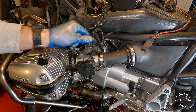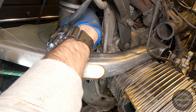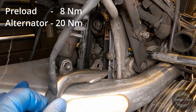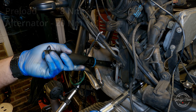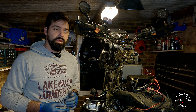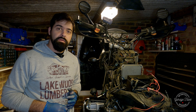Plugging the injector back in and tightening all the clamps. As I mentioned at the beginning of the video, I'm also going to re-tighten the alternator belt as it seems a bit loose. The alternator is all loose, I've got a torque wrench on the back of it set to 8Nm — that applies the correct tension to the belt — and once that's good I can torque the other three bolts to spec. I think I've covered all the interesting bits, so I'm going to stop filming here. Off camera I'm going to put the plug back in the crankcase, fit the cover, exhaust, crash bars, fuel tank — everything — put it all back together, and I'll see you when it's ready to be fired up.